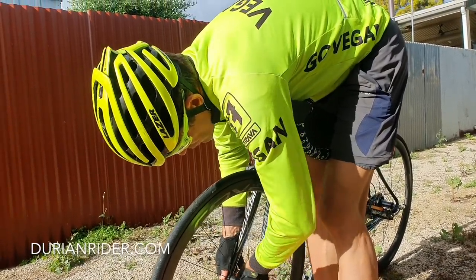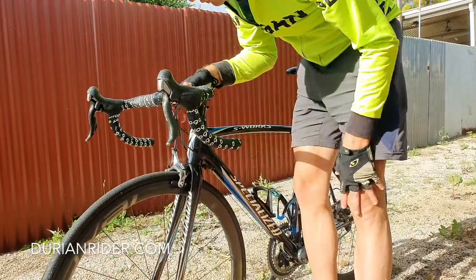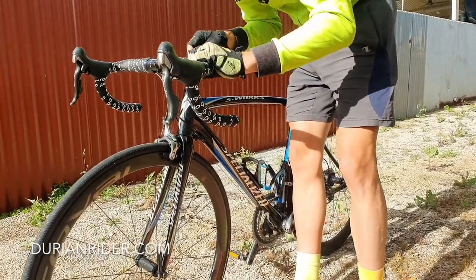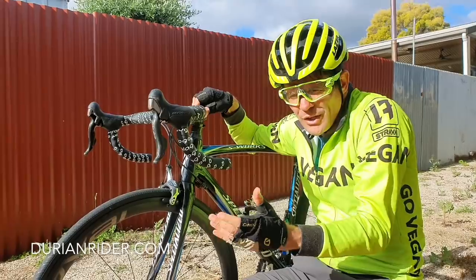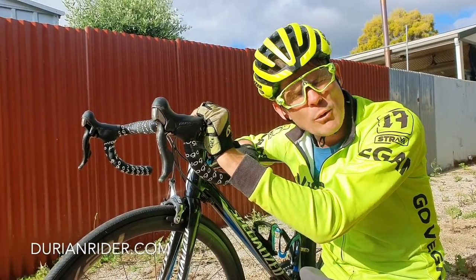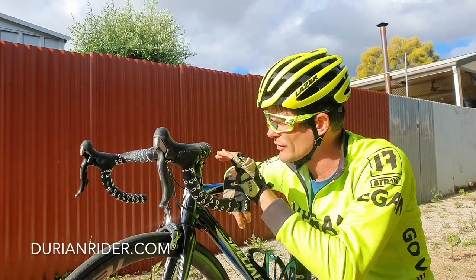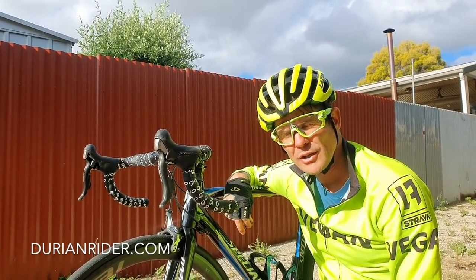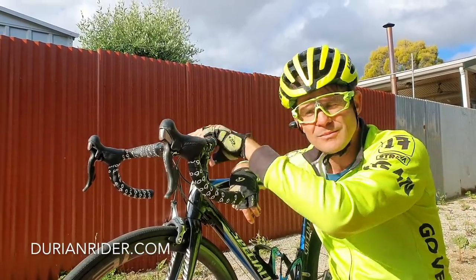This bike — I give it safety approval. I've checked the fork tips, they look in really good condition. I've checked inside here, put the torch inside — this all looks really legit. We'll tighten up this headset, set the tension, use a torque wrench. When I get home, double-check the tension. We're good to go. This just gives more confidence, because what's the point of hurtling down hills without checking? I'm a bit more OCD about safety than the average person, but maybe I've seen more horrific crashes. I'm going to take these bars off as well and check in here for any crimping or corrosion of the alloy — that can be another video. Put the audiobook in your ears and just focus and learn how to do it. Very simple stuff.